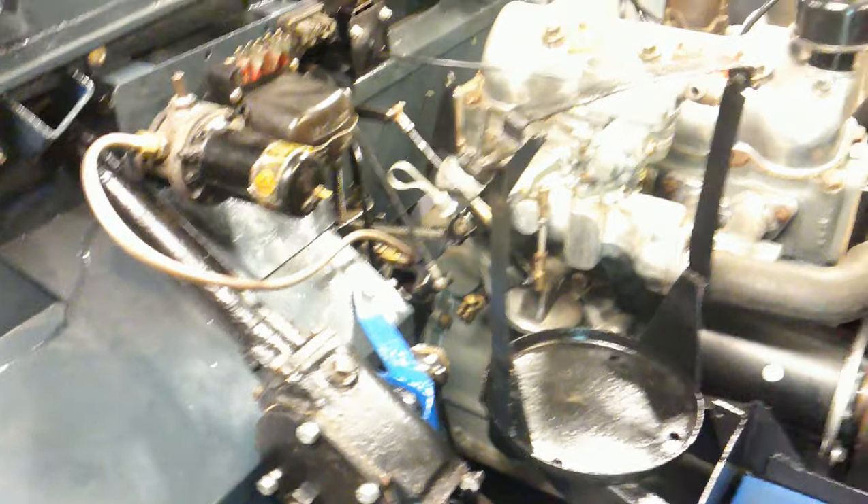We have choke, throttle, brakes, clutch, everything — it's all connected. My next job is the seat box, which I'm doing now. Just start to clean all that up, take the old paint off, start sanding it down. But there are a couple of broken bits which are quite common on series twos and threes — where it sits on these bolts, it obviously just wears through and vibrates, and they always seem to break there.